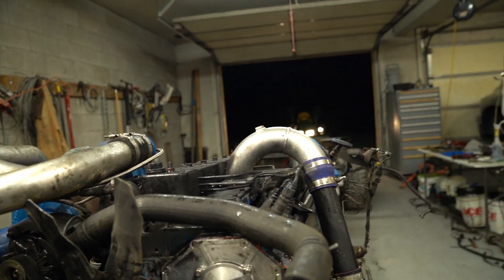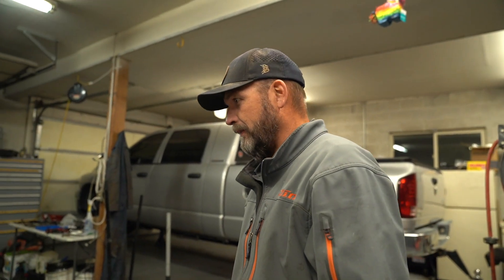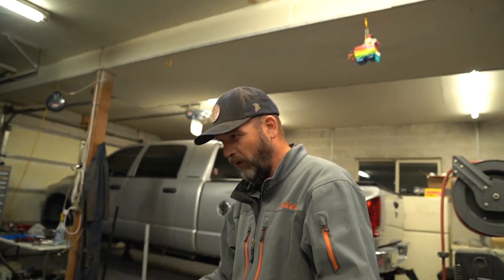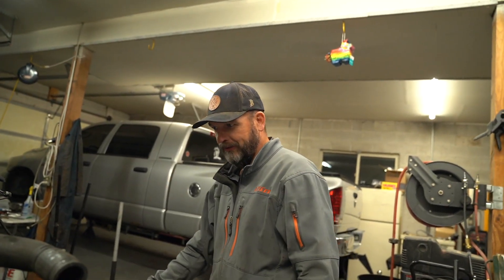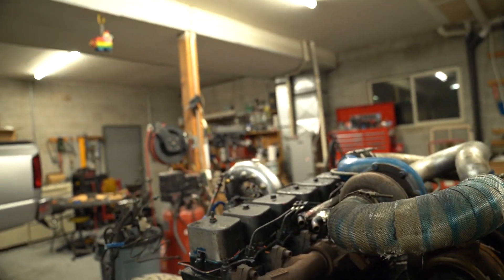You can see now that we've washed everything off, we should be able to see where the oil leaks are or what starts leaking, because before everything had oil on it and you didn't know. So now we can go ahead and start ripping off the exhaust and the rest of the remaining stuff on the engine.